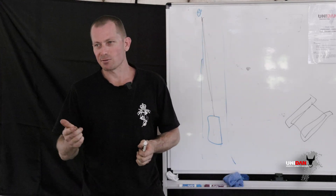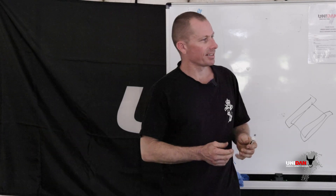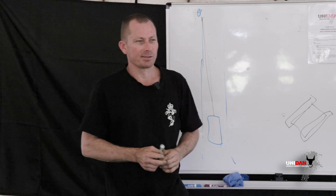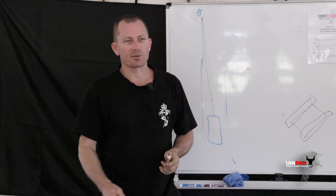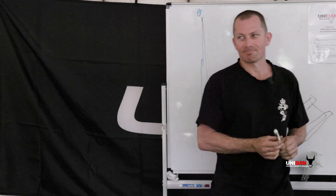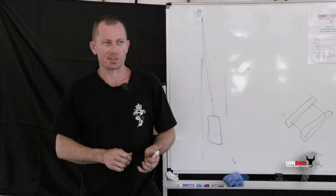Likewise with shackles — a 4.5 or 8.5 ton metal shackle flying through the air will go straight through your vehicle, through the sides, the headboard, everything, and come out the other side. A soft shackle rated at 25 ton or whatever — if that flies through the air and hits you it'd be like getting punched in the head, but it's not going to kill you. So try to make the switch to synthetic tackle wherever you can.